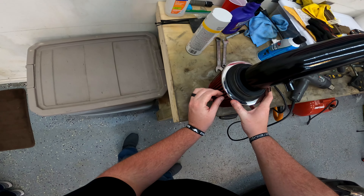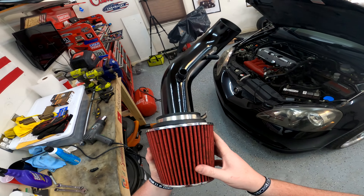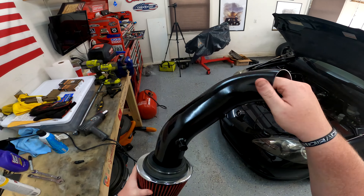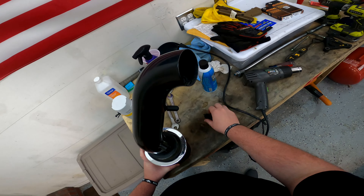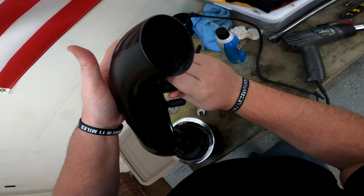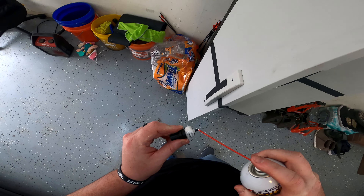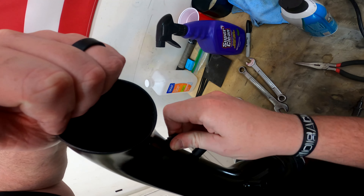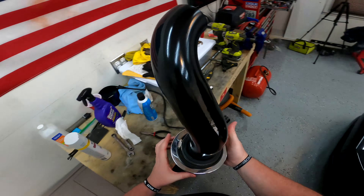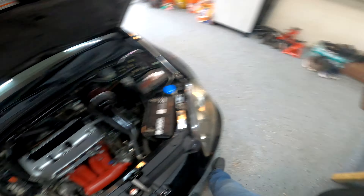Got this thing looking much, much better. What you guys didn't see is I actually used Super Clean, sprayed it down and hosed it off outside to clean it. That's not an advertised functionality of Super Clean, but this thing was dingy as hell and now it's not. We've got to get this installed — this little line here is the inlet air temperature sensor. I lubed it up first, and look how easy that was. Let's get this bad boy reinstalled. I think that looks a whole lot better, you guys.